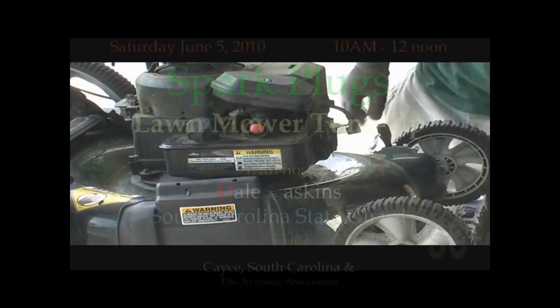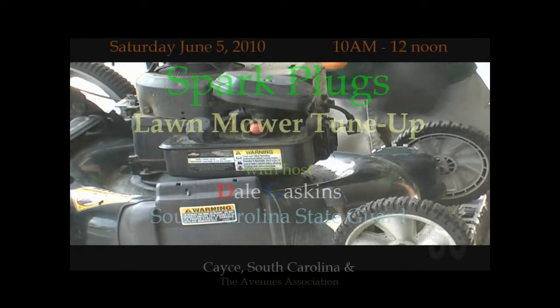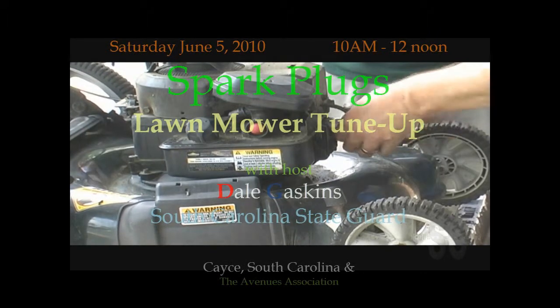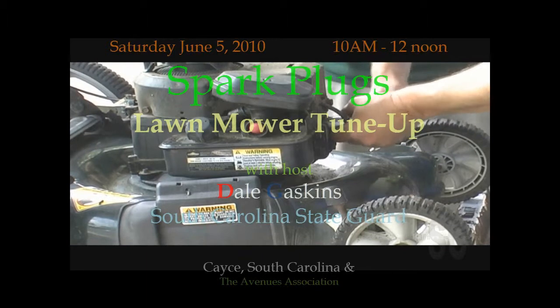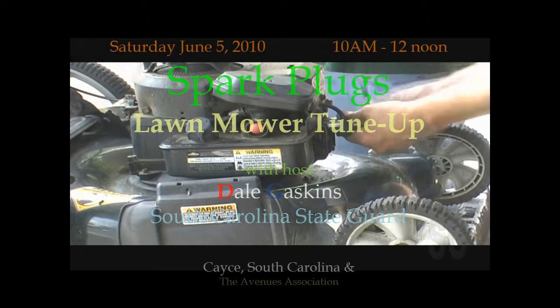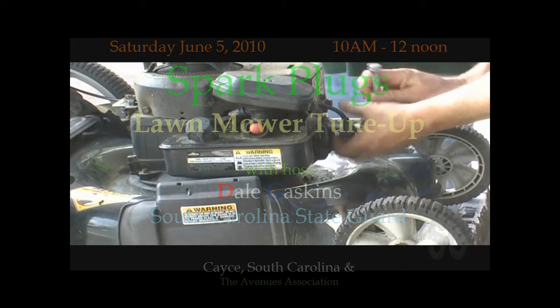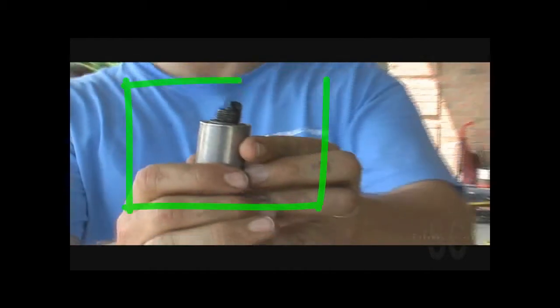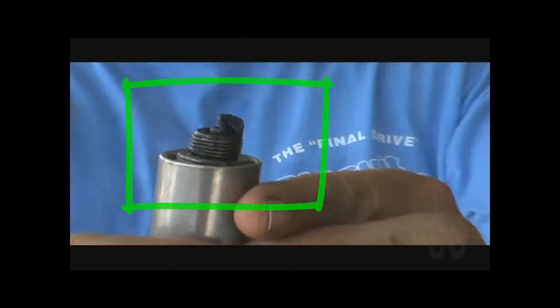So we want to pull the spark plug. That spark plug didn't have any anti-seize, something we're going to show you in a minute. And this is an absolute great example of how messed up a spark plug can be. It is one big gloppy mess of carbon and burnt oil.